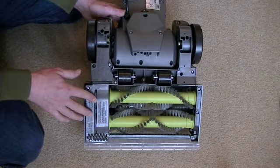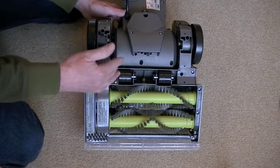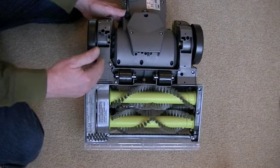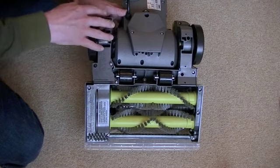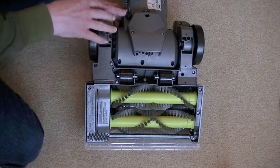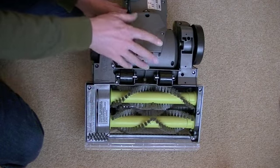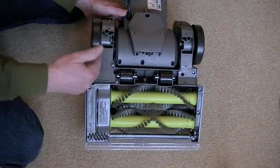The problem I had with the faulty machine — as some other people have reported — is that the drive belt has sort of moved along on the pulley at the back, melted the pulley, and the machine seized up. There's been a smell of burning and sometimes smoke coming out of the machine. The smoke is caused by the burning rubber; it's nothing to do with the motor. The motor is fine — it was just the fact that the belt had shifted.